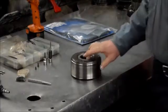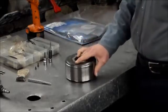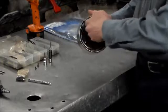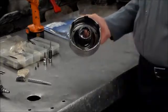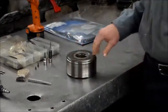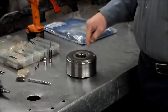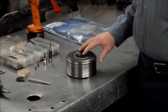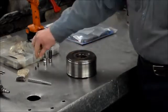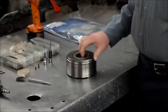What we're going to do today is work on a K2 clutch drum out of a 722.3 Mercedes. We're going to change the O-ring in the bottom piston that is riveted to the drum. We're going to grind the rivets off, knock the piston out, clean it up, tap the holes, go back with the new O-ring, and then put the bolts back with Loctite.